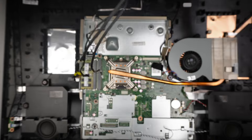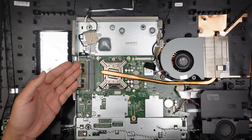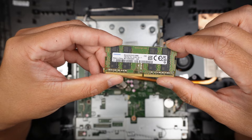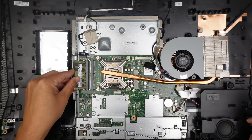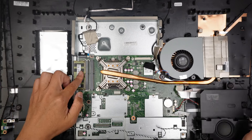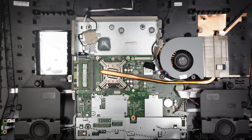At this point I'm going to put the screen here on the side. Here you can see the entire internal part of the computer. You have two RAM slots — the first one is already used, and you can add additional RAM. This runs on DDR4; you can see it says PC4. To install, slide it in at a 45-degree angle, push right in the middle, and you'll hear the clicker lock in and hold on to the RAM. Get another DDR4 RAM, slide it in, push it down — now you have increased the RAM on your computer.